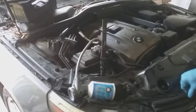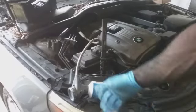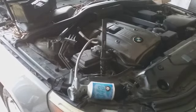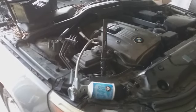Well, I'm gonna let this run on, take its course. I mean, it's nothing special administering Freon, so just let it take its course. Don't overfill it. I mean, the gauges are general. But once you take it for a drive, let everything circulate, check the temperatures, make sure the temperature's nice and cold at low RPM, high RPM. So, other than that, everything's good. Peace.